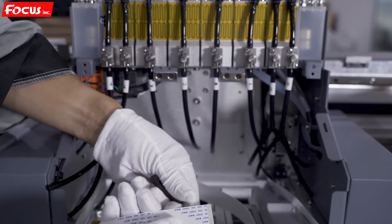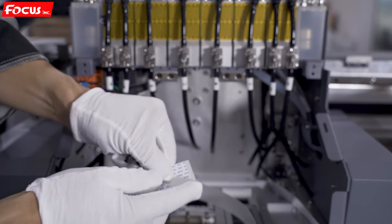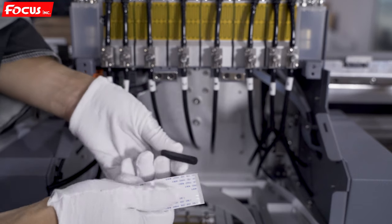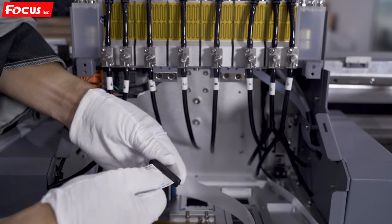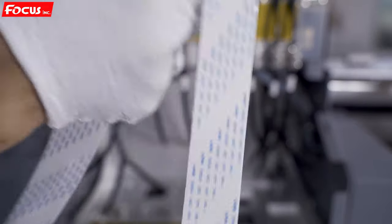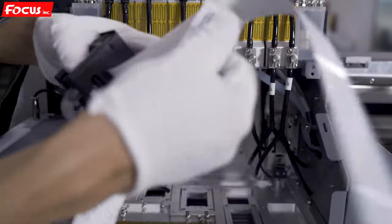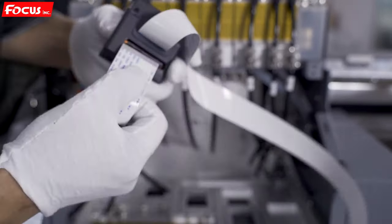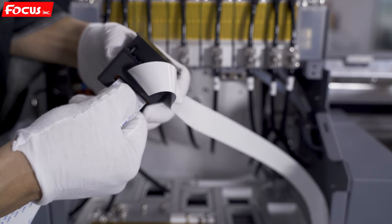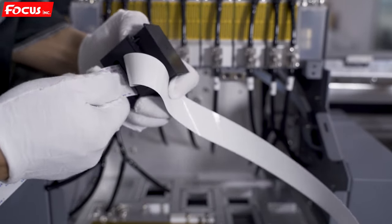Find the brand new head cable and be sure all the pins are not damaged — they should be flat, not scratched, no dirt, no liquid. Then we also use the cable to go through the rubber and install it on the top port. We put the print head in position and install back the cable. Make sure it's flat and no damage.